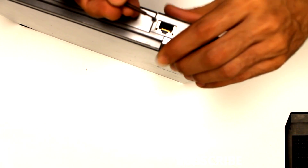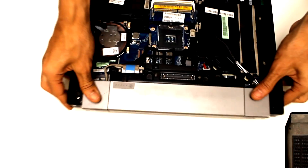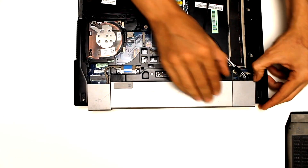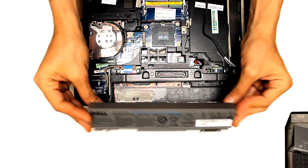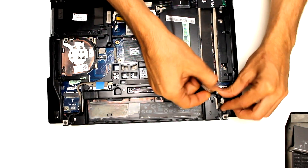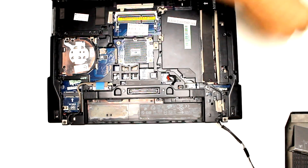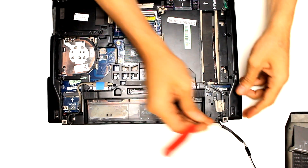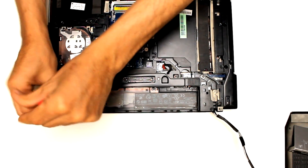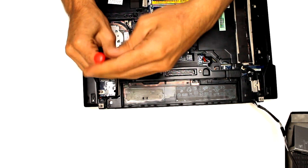Here is the hard drive — same as the CD-ROM, it's held by just one screw. You open it and slide it apart. An important thing: once you're taking off the screws, make sure you put each screw with the part you took it from, so when you reassemble you'll know where it belongs. If the screw is small, there is a number — you'll find it mentioned. Write it on paper and put all the screws labeled accordingly. The number or letter indicates the screw size.